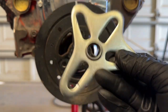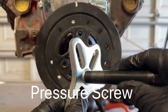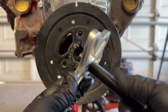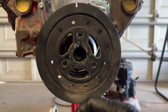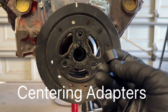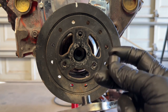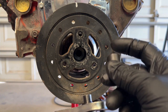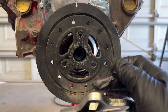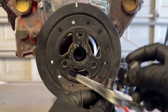The first thing we're going to do is take this piece here and feed it through so it screws in. We're just going to run it in a little bit. Now on the tip, there are three different applications you can use: there's a flat one, completely flat on top; a pointed one that's bigger; and another one that's pointed but smaller. I'm going to use the bigger one because it'll center the shaft better on the crankshaft itself.